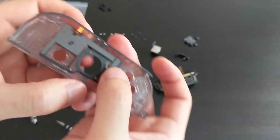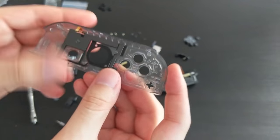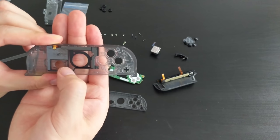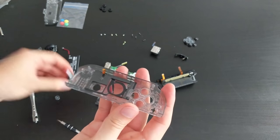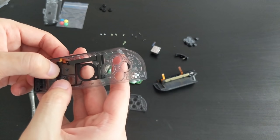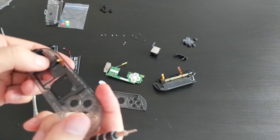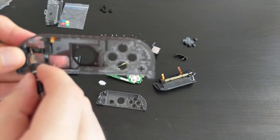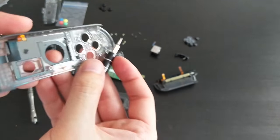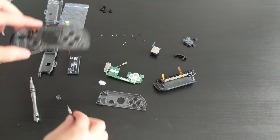Okay, so there's some notch here and a notch here. So just make sure it's there and then just press it down, and then it should still have enough adhesive to stay down. So you make sure that it matches with that groove and that groove there, and then you should be good. And now I'm gonna put in the IR blaster or whatever it's called, and sticking this back down. Okay, that is back down.